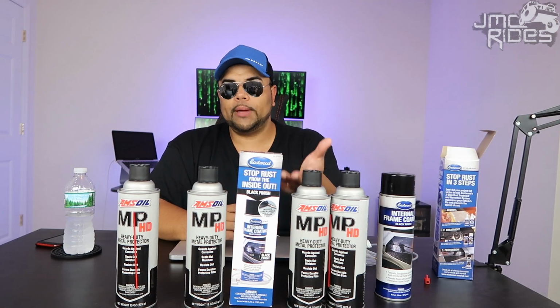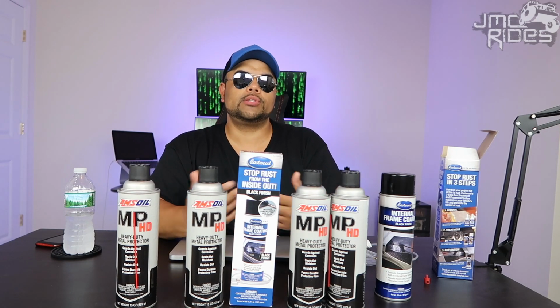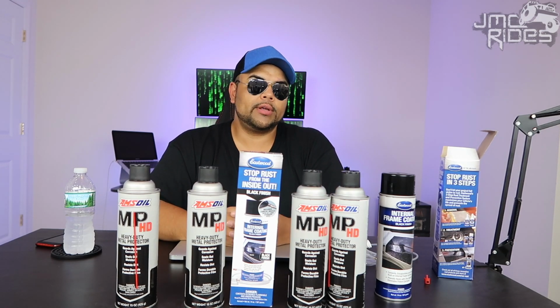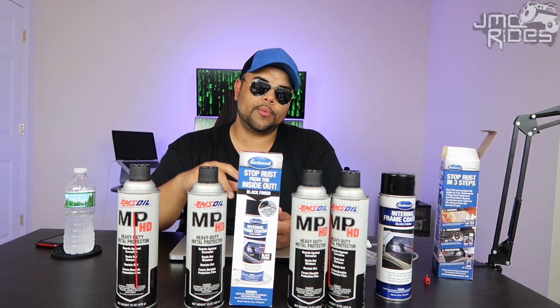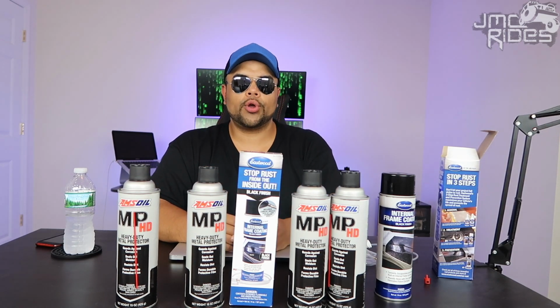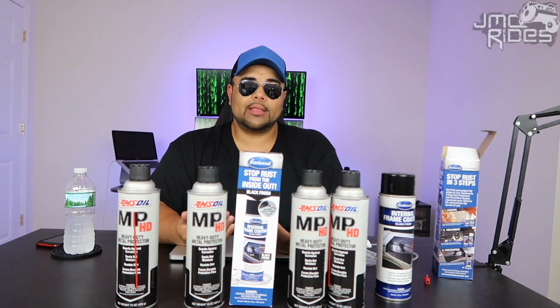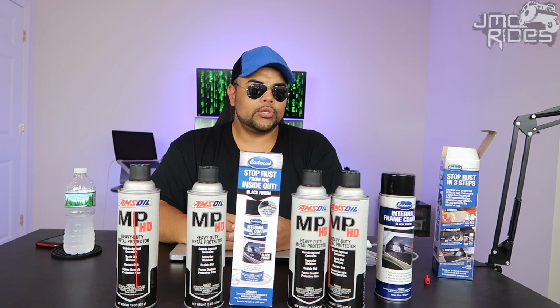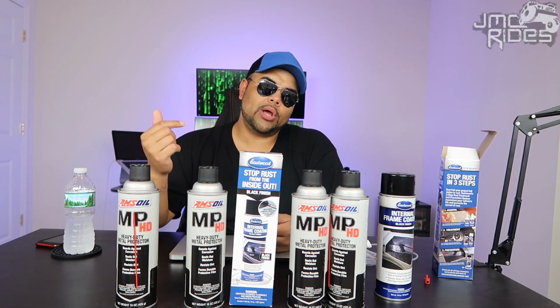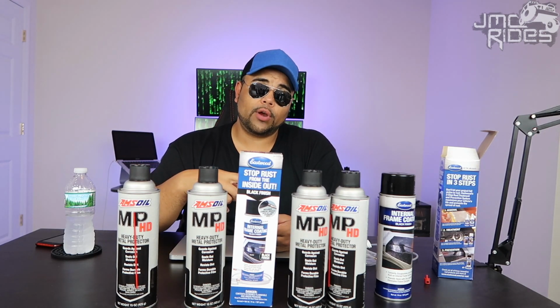do, depending on what you have available, it may be slower or faster. Now, if you have, for example, an air compressor, after you flush it out, go ahead and just hit it with the air compressor to try and get a lot of that water out. This time of year is probably the best time of the year to do this because it's really hot outside, it's summer. So I'm going to go ahead and flush out the inside of my frame.